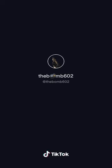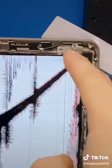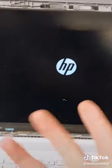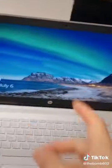Now I'm going to put the cover on that one. Replacement - it's broken, I swear. See? Very broken. This bezel doesn't have any screws, so we're just going to start with unclipping the bezel. That was harder than I thought - it was stickered in. Now for four screws around the edges. Make sure it's off and the battery is out, and we can go ahead and work with the plug. This is a 30-pin, 15.6-inch screen. Unfortunately I didn't have one, so I had to find one for this model. I just put the new one in - well, it's used. Refurbished. Time to screw in all the screws, snap the bezel in place, clean up the screen. Gosh dang beautiful.